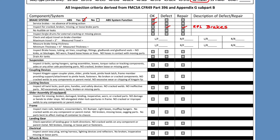Now we move on to audible air leaks. This is for any air leaks on airlines, glad hands, brake valves, anything that's leaking. If we replace it, we have to make the notes. If it's okay, we just mark it okay. We're going to say that the brake components are okay, that there are no defects, so we're going to mark it okay.